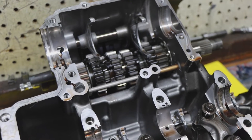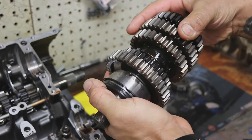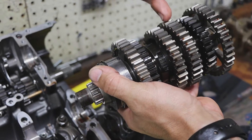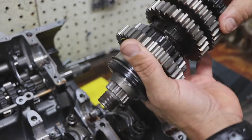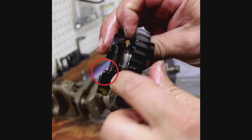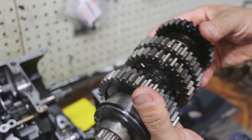The crank is out. We've taken the output shaft of the transmission out. This is where they were having shifting problems, particularly third gear. On the output shaft you have six gears. We take first gear out, then the slider gear that makes third gear work — and that's where we see the first spot of wear. The engagement dogs that are normally square are now round, which is why it's jumping out of gear. And you can see the same things happening in third and fourth gear also.